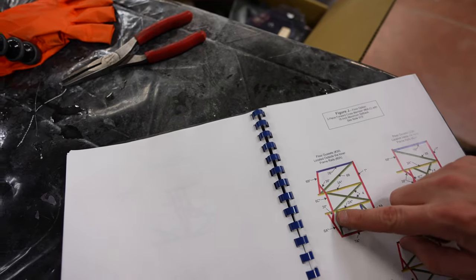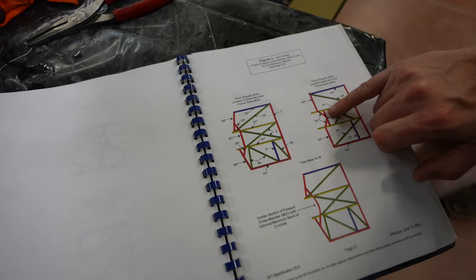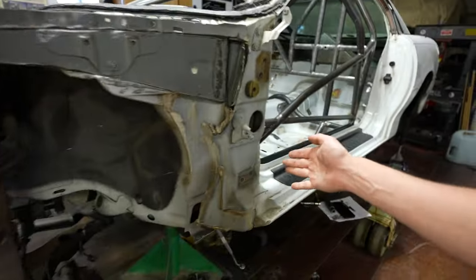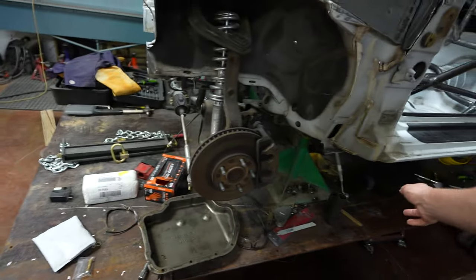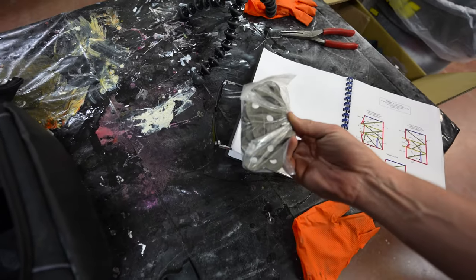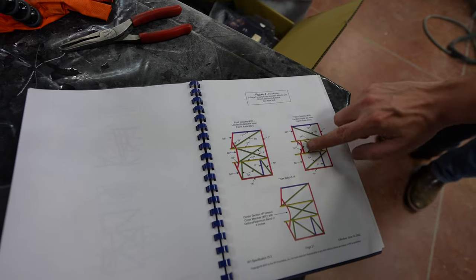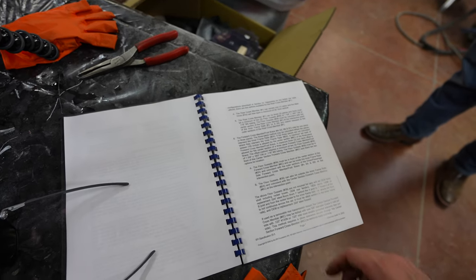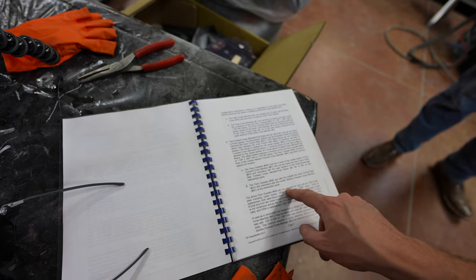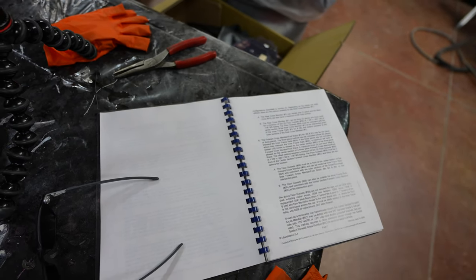Looking at the rulebook, I'm building crossmember 6C — a straight bar that can be placed 16 inches back, which works out perfectly. We already verified that measurement. It can be made in three pieces as long as you use the correct size and the little brackets. Interestingly, I thought I'd have to build the above-floor gussets (rule 39), but the notes say those are not required for cars with OEM body shell — including rocker boxes, OEM rear fenders, OEM doors, and OEM or replacement steel floors.